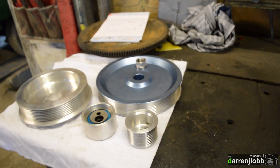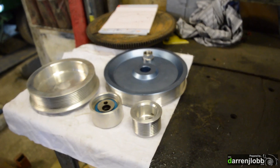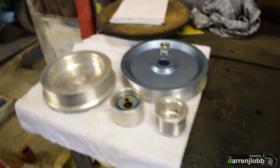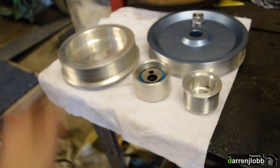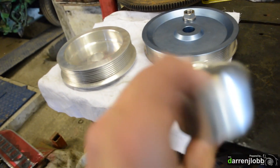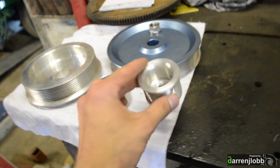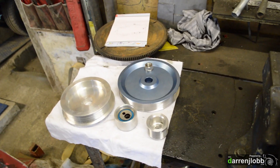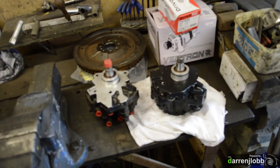I actually got that fuel pump pulley quite a while ago just to do some measurements and make sure things were going to work out. I've had three others made up - there's actually four, one of them has just disappeared somewhere - so you've got the idler and the tensioner which has gone missing somewhere, an alternator pulley, and a replacement crank pulley. They're all made of aluminium so they're a lot lighter than the original ones. Done away with the dampener, just made it a simple lightweight pulley - obviously 8 rib versus 6. The sleeve basically presses over the top of an OEM tensioner bearing, so when the bearing goes bad you can just push this one out and press another in, keeping the same sleeve. We should have just enough clearance on the underside of the engine according to my calculations. That's basically what we're going to be doing to run the 8 rib belt to run the CP3 on the front of the DW10.